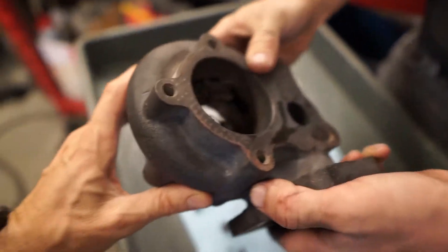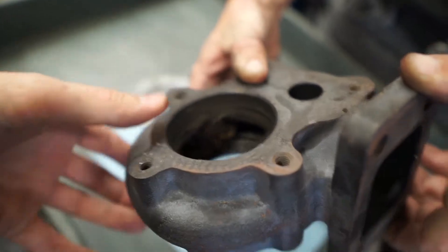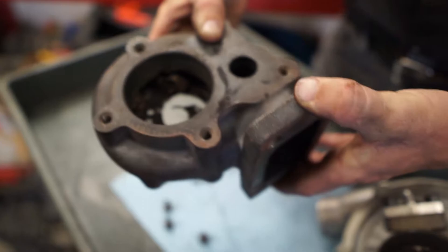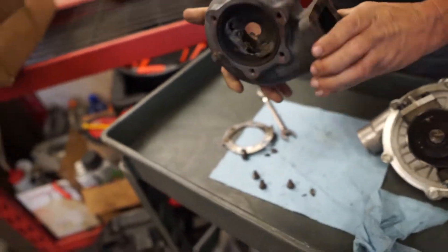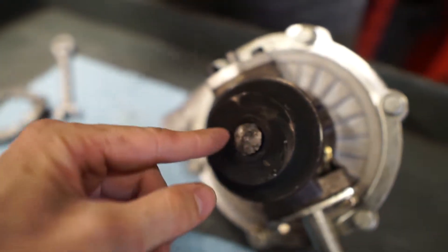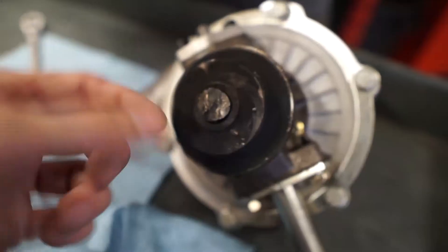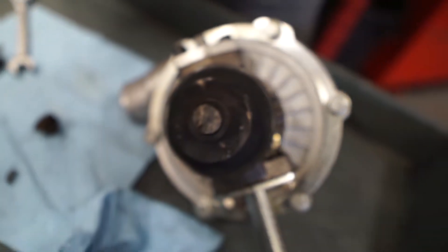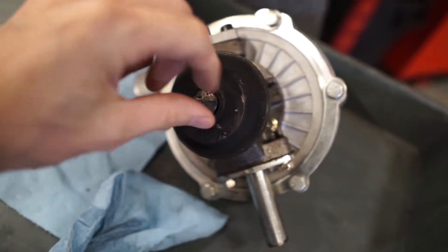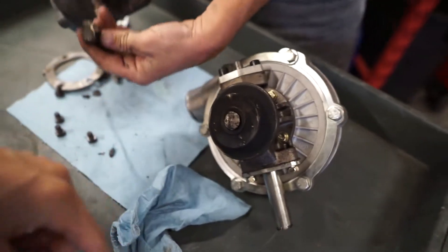This is crazy. See guys, this is why we can't have anything nice — we just break everything. This car was actually going perfect and I was super excited. We were making like decent numbers. Oh my gosh, look at this. I wonder why we weren't making any boost. I thought we broke the shaft, but we kind of did — it's like sheared off. I guess the title of my video is not a lie. I broke a turbo in half and it's basically in half right here.